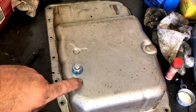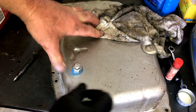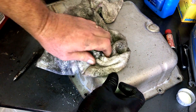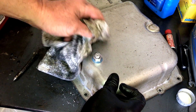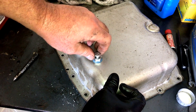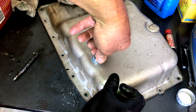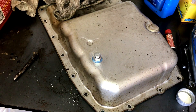On the outside I put a little bit of blue RTV just on the bolt and on the washer — nothing on the inside. That's where you'll drain it; just screw this out. Every time you change the transmission fluid every 50,000 miles or so, just screw that out and it drains, then take the pan off very easily. That's it. Hope it helped.